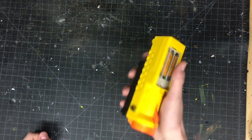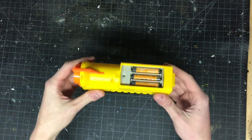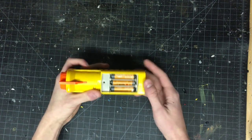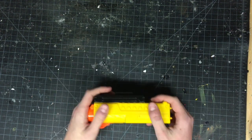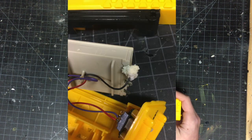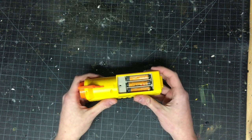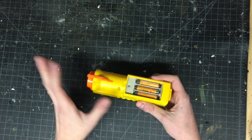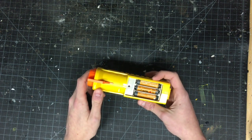The first thing in this episode — not in the thumbnail, and I already fixed it — was horribly corroded and missing the battery door. It had zebra tape on it. I got a little excited with the vinegar, and I'm glad I opened it up to clean the vinegar out, because I found this: a marble-sized chunk of corrosion had formed on one of the leads. So I dunked that side of the battery tray in vinegar, left it there for 10 minutes — that's how long it took to fully dissolve. That is the worst corrosion I've ever seen.